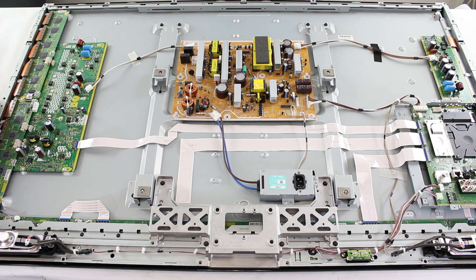In this video we will be taking a look at where to begin troubleshooting when you are hearing a clicking in your plasma TV, by taking a look at troubleshooting the Y board and X board. To help locate parts, over here we have the Y board, which can also be known as the Y sus, Y sustain, and SC board.